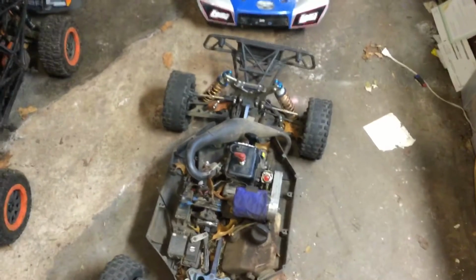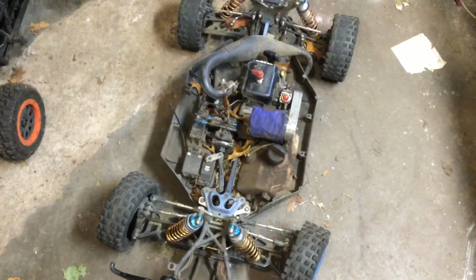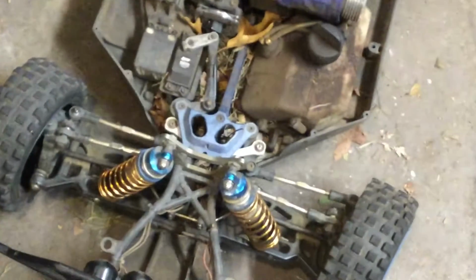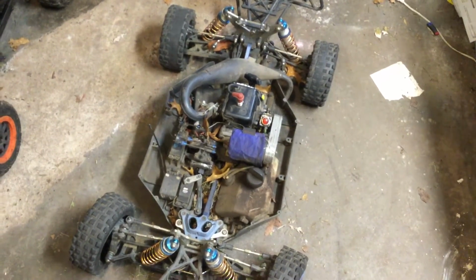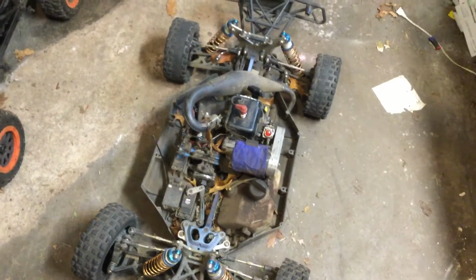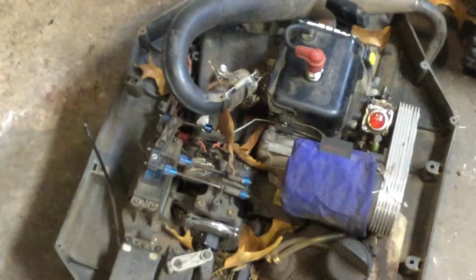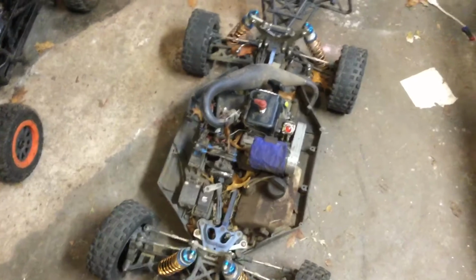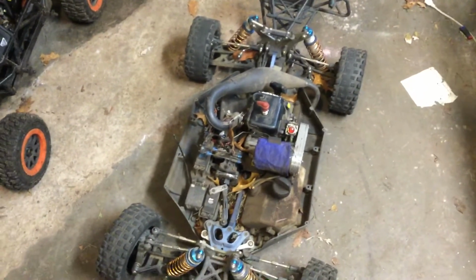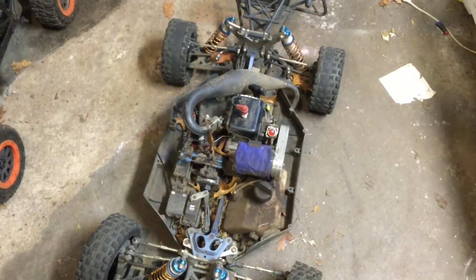Back of the truck, it also has a Victory big bore pipe. It has a Team Chase steering drag link, as you can see. A lot of grass in there. I run outerwears all the way around on the truck. And also, kind of hard to see, I use the MIP head studs. They allow me to really bolt the header down instead of trying to sneak like a 4mm ball driver in there to tighten them down.